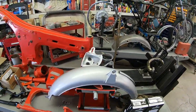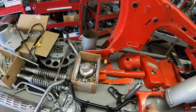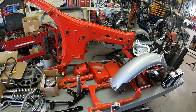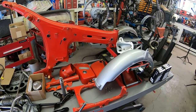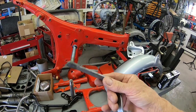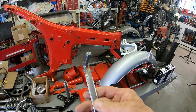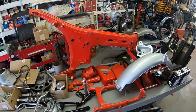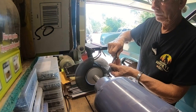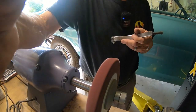So we're getting things together here. I got the paint on the stuff that we worked on the other day. I'm going to buff this up — you want to make it as shiny as you can everywhere, because you're going to put the whole thing in the nickel plating. So I'll take it over on the wire wheels first and start buffing it, then use a Scotch-Brite wheel. That way it'll look a lot nicer when it comes out of the nickel. And over here I've got the Scotch-Brite wheel.